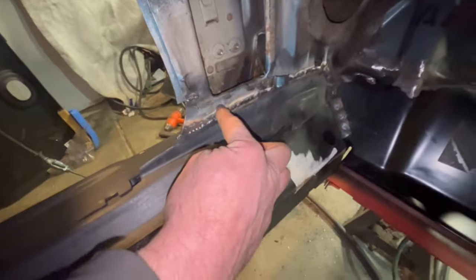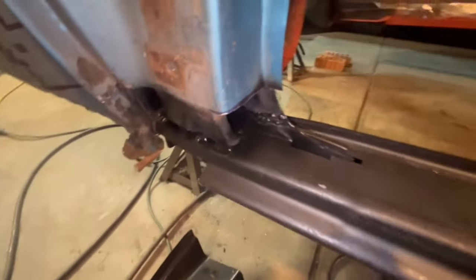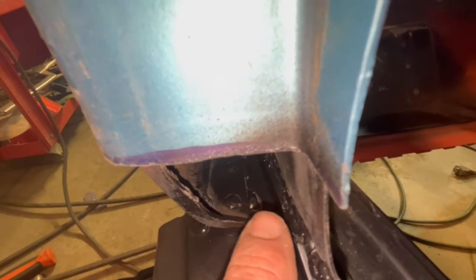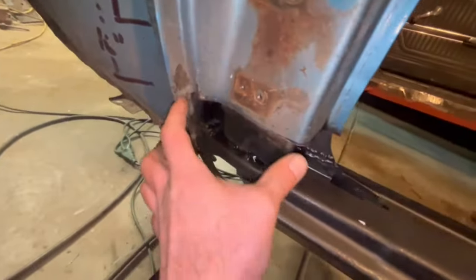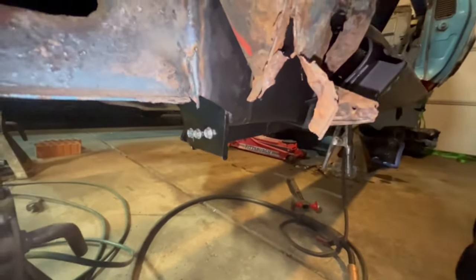Welding is all squared away and done. I got it all tied in and stitched in really good, spot welded all through there. I went ahead and sprayed some primer. I was able to get in there and get all three of those little spot welds, but I also did some stitch welding on the outside and even on the inside. I've got spot welds one, two, and three — I got them, but they didn't feel like they penetrated like I wanted to, so I went ahead and stitched them in just the same. I'm going to work on getting this cut out — use the old chunk of metal as a template, lay it right on top, trace it out, cut that out, and get that put in here. Then there's the outer cowling piece that needs to be doctored up.